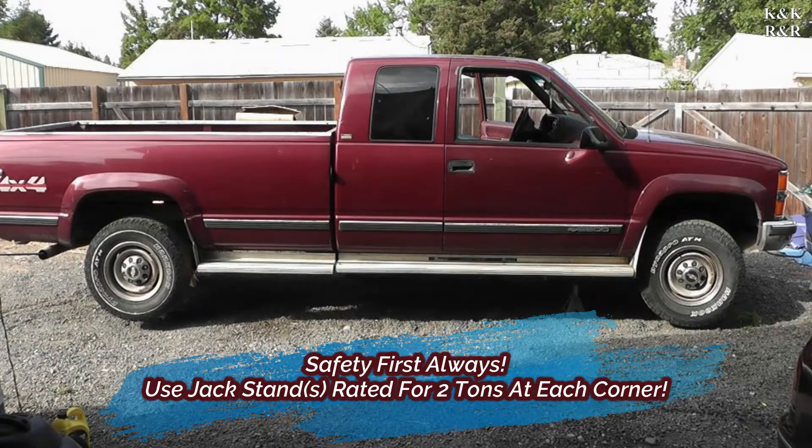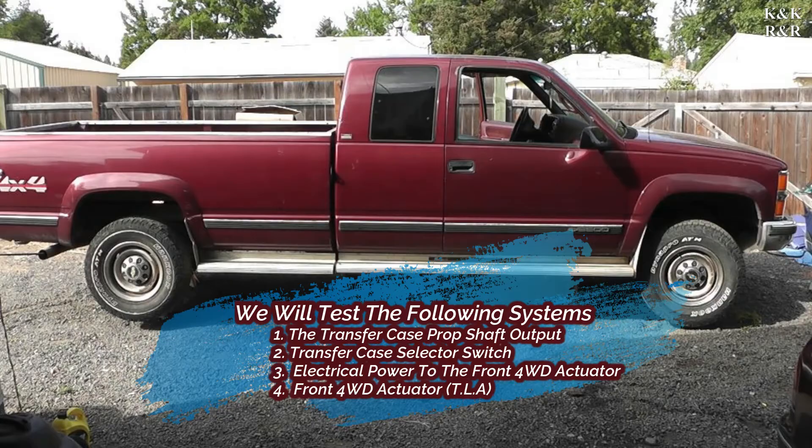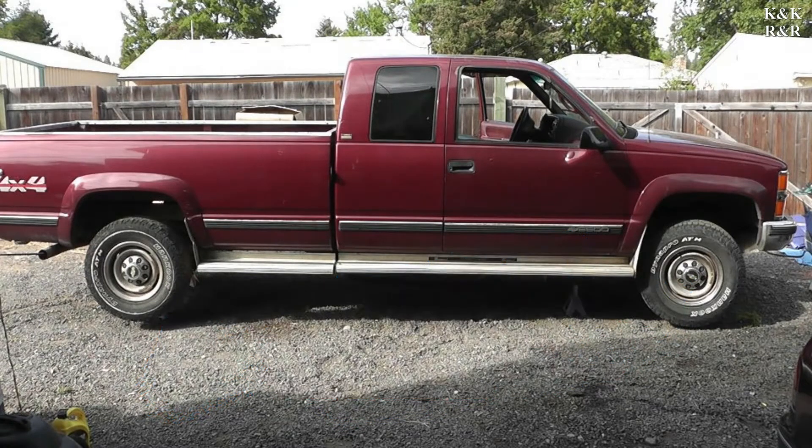You do want to make sure you are on a safe surface. We're doing this on dirt, but during the summertime back here, this dirt is pretty much as hard as concrete — but be safe when you do this test. The series of tests we're going to run: first off, we're going to do four-wheel drive high. We're going to look at the transfer case, make sure we have power going where it needs to, and then we'll show you where the two most failed items are in a GM IFS.